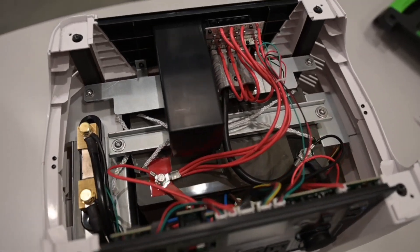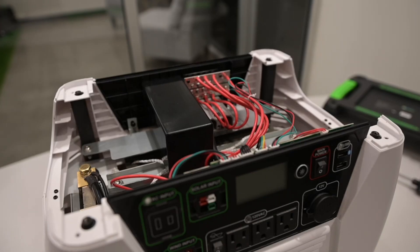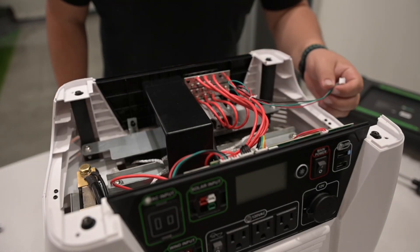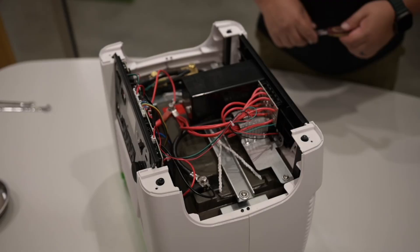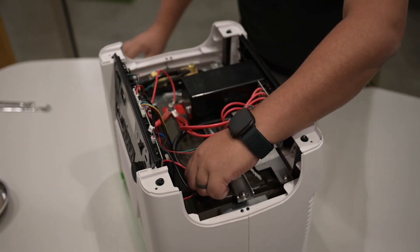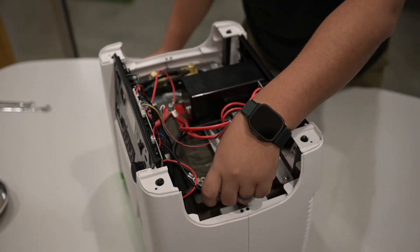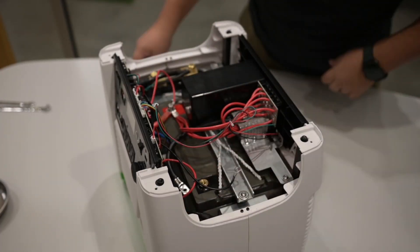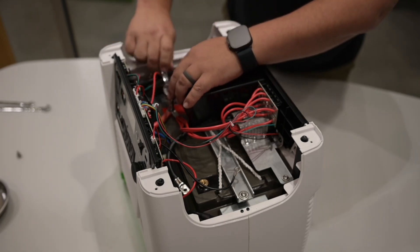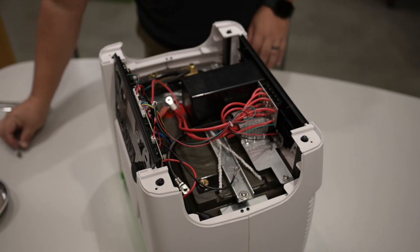Up top we're going to be working with the battery cables and a few ribbon cables for the control panel. Start off by disconnecting the 3-wire ribbon cable from the front control panel. It's important to note that you might hear the battery cables arc when they're being removed — this is normal, so don't panic. Grab your 10mm socket and, just like on a car, always disconnect the negative battery cable first. After and only after the negative battery cable has been disconnected, proceed to disconnect the positive battery cable. Now that you've got both battery cables disconnected, go ahead and push them aside.